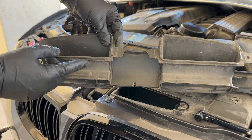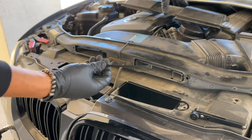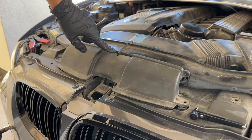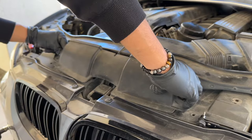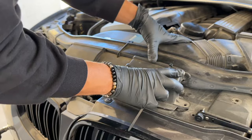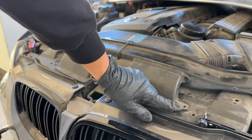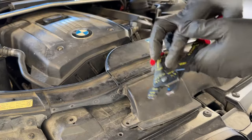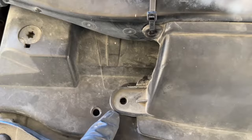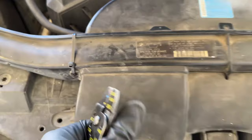Now we're going to throw the nostril right back on top. The scoop is basically going to hug into these little seams right here. I'm going to use zip ties — just reinsert this back and make sure the middle slot aligns. You may have to push it down and give it a little force. It's easier if you come in from the front to the rear, then push it into place. Once your holes line up and everything looks flush, zip tie it or put your screw back in and cut off the excess.